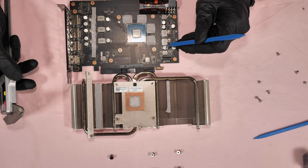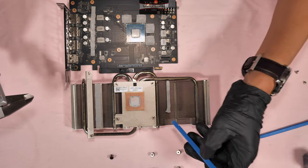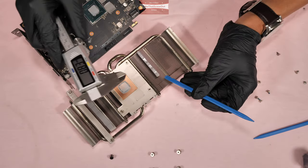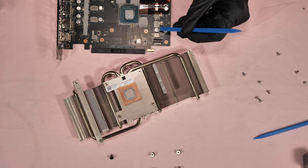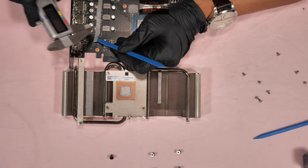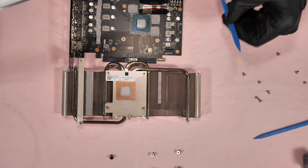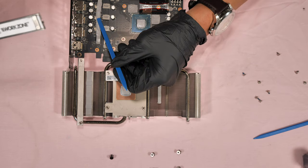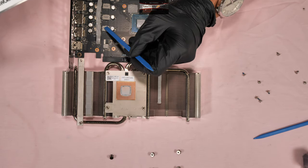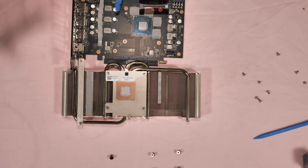But these small black chips here, and this side here, have a thicker thickness. This one here has a one millimeter thickness, and this one here is exactly the same — it's a bit thicker, one millimeter. So this side — this one and this one — has one millimeter, and the VRAM and the three MOSFETs have 0.75 millimeter. So it's thinner versus thicker.